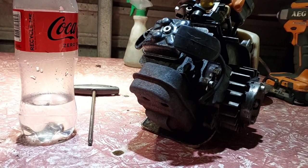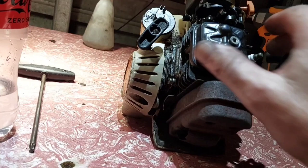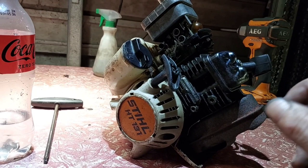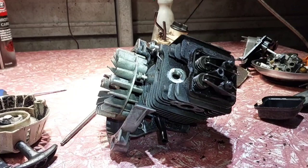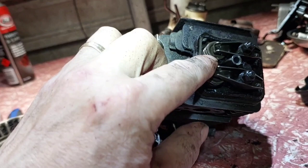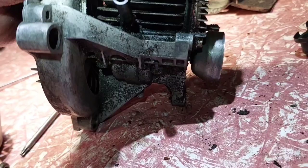It's got good compression. As far as I know it's a two-stroke design — actually no, two-stroke fuel but four-stroke valves. It's got valves, they normally wear out because no one adjusts them and you burn a valve out and it doesn't work properly. I threw away a good Honda motor once because they had burnt valves. Valves need to be adjusted periodically. I'll pull it apart — I might be using two-stroke petrol. It's got four-stroke valves but runs on two-stroke fuel.